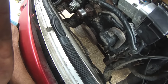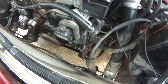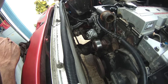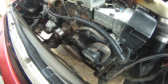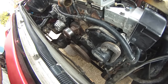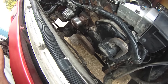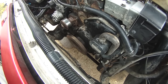The whole time I'm taking this thing apart, I'm beating myself up trying to figure out exactly why I'm tearing apart a perfectly good running vehicle that doesn't leak a drop of oil. I've torn the transmission apart for preventative maintenance that it didn't really need, and here I am tearing apart the front half of this engine to look at a killer dowel pin that may or may not even exist on this casting. I guess the upside would be if I pulled this cover off and found the pin precariously dangling — that would be awesome. Anyway, I've got the fan assembly and fan shroud out. I just need to pull off that harmonic balancer pulley and blow things out real good so I don't put a bunch of dirt into the crankcase.